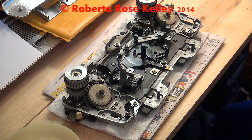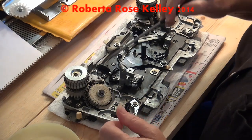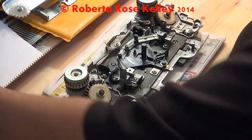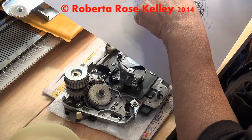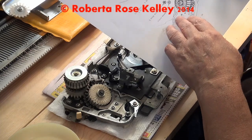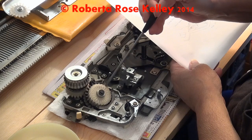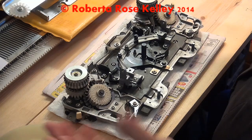I'll keep my camera handy in case I miss the picture. First of all, this here I believe has to come off first. As I was looking at the service manual, this little piece of metal does have to come off. Then the sub-drum comes off first — there's an E-snap ring and then a washer underneath it. I do see some lint in here and there, so it could be inside the drum or on the shaft that's holding the drum.